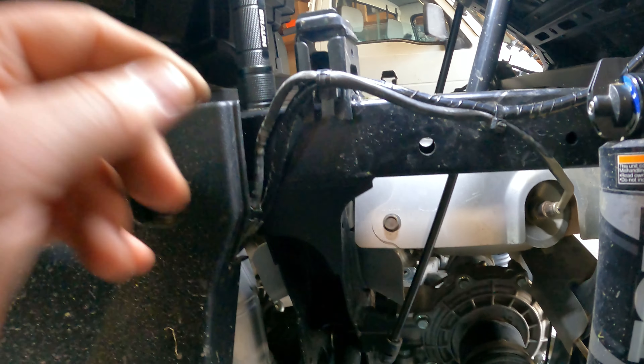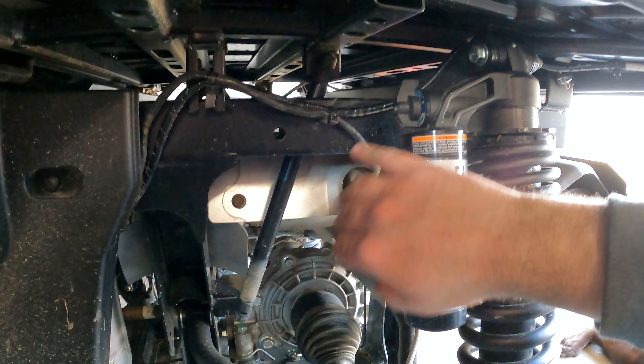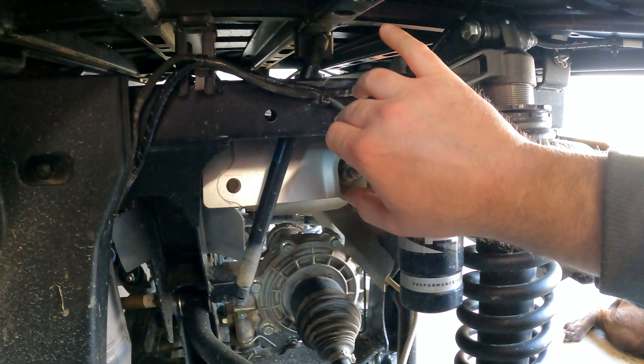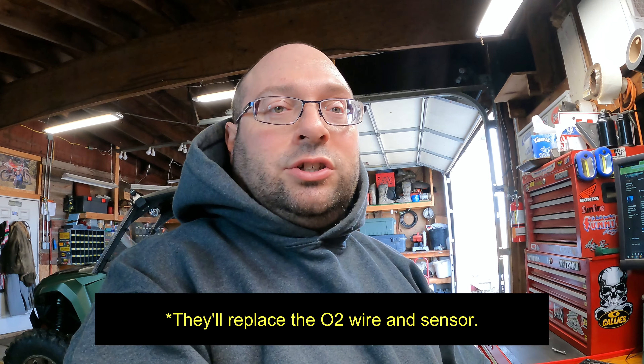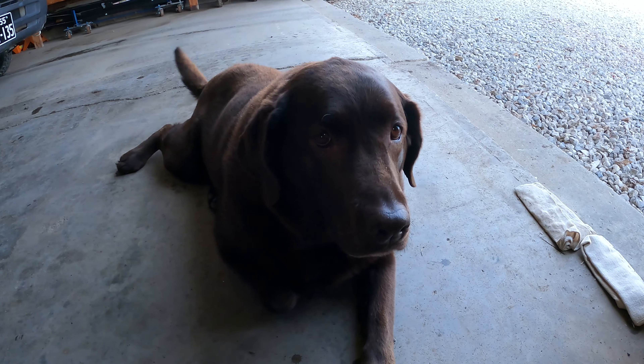So it should be good. This is what they're going to do - put it under the frame like that, and there's less chance of it rubbing. Everything looks good. That's it - do your own recall if you want, use your own judgment, or take it to your dealer. They'll replace everything if you see wires that are worn. I don't know what a short would do - it would probably mess up that O2 sensor, your machine would probably be fine but the emission stuff wouldn't. That's how you do it - might as well do it yourself if you want, but use your own discretion. Thanks for watching!